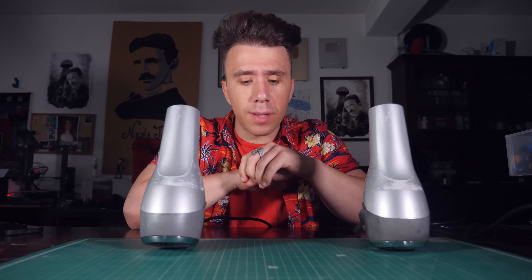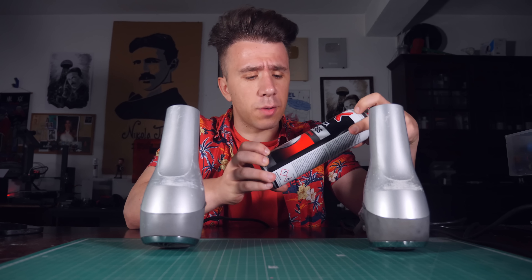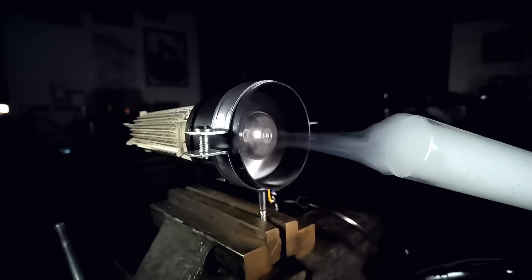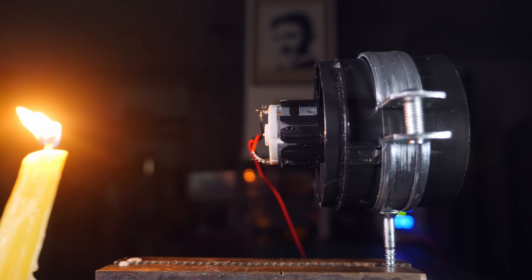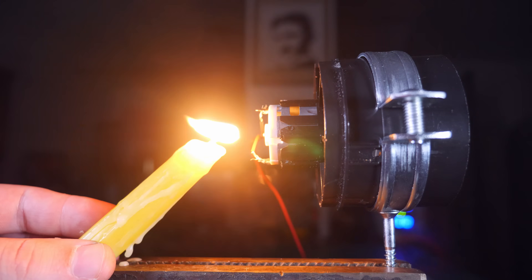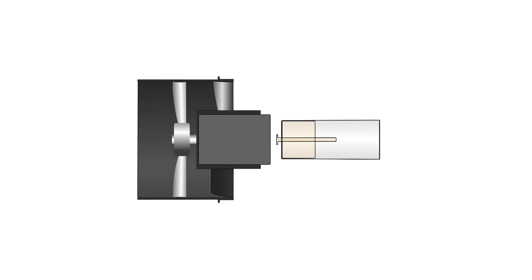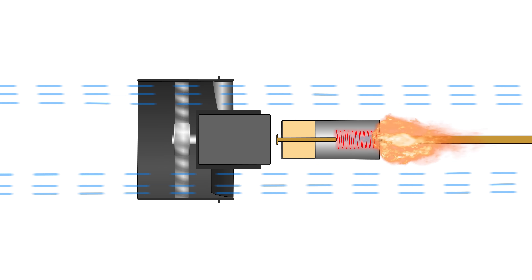For starters, I think I have to inject the fuel after the fan, because as we have proved, injecting before the fan doesn't really work. I sprayed the brake cleaner directly into the heating element, but the high-speed air creates a kind of shield that doesn't let the fluid through. I could just lower the fan speed, but then I can't go full speed, and that's no bueno. The best way to solve this is to use the dead spot behind the motor. See how the candle flame not only doesn't go out, but behind the motor gets stronger, while outside that area it's just extinguished. We can put an igniter here using the nichrome wire, and inject the fuel directly into it to get steady combustion. The best part is that the igniter is not in the way of the flowing air, so the combustion is actually making the fan more powerful.